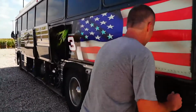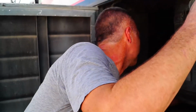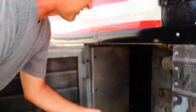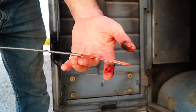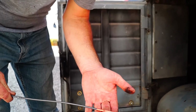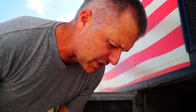The next thing I'm going to do is pull the transmission dipstick and let you see the fluid in it, so you can see how clear it is. This is the transmission dipstick, and it is really, really pink fluid. It has no burnt smell to it at all. It's a 4-speed Allison. I believe these are an HT 740. It shifts out very well.